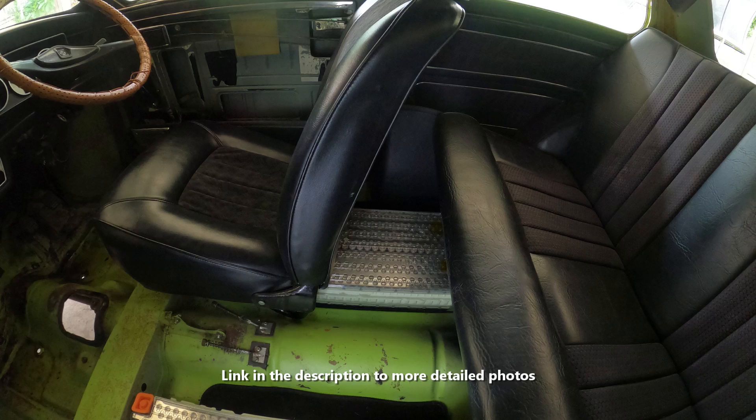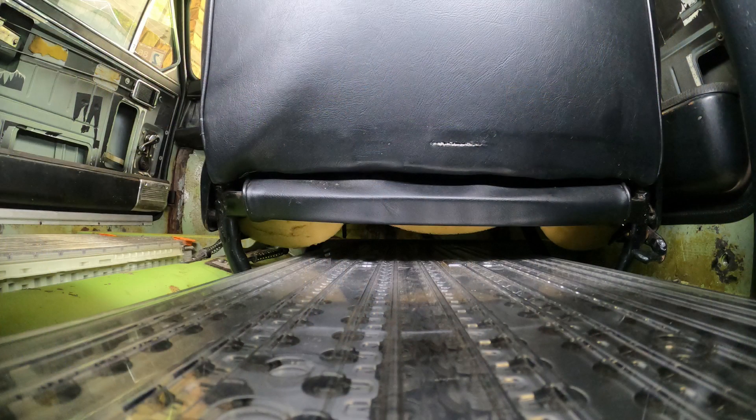For the Hyper 9 I'll need five Tesla modules. I'll probably run three in the front and two in the boot. Unfortunately, the plan to have batteries down on the floor isn't going to work — it's not overly practical. I'm an adult, my head is touching the roof liner and my knees are up pretty high, so if we lift the floor up another four inches we're going to run out of room. There's also the risk of something coming through the floor pan if we hit a rock, so it's a cool plan but not ideal.